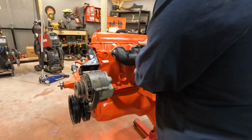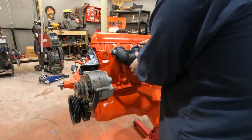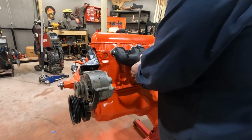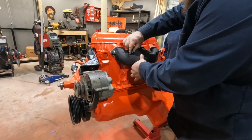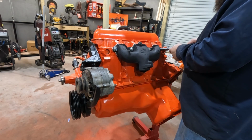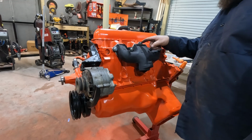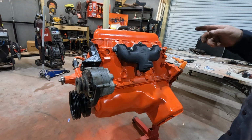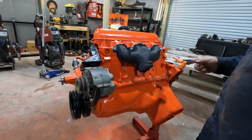If you watch the video of taking this engine apart, center bolts broke off. I did drill and tap those off camera, as well as we had a broken bell housing bolt. All right. Did have to use a little shorter bolt in the middle. It did bottom out. No big deal. So I think put the other side on. Go ahead and slam the spark plugs in right now since it'll be easier. And flex plate. I think we're ready to put this thing in.